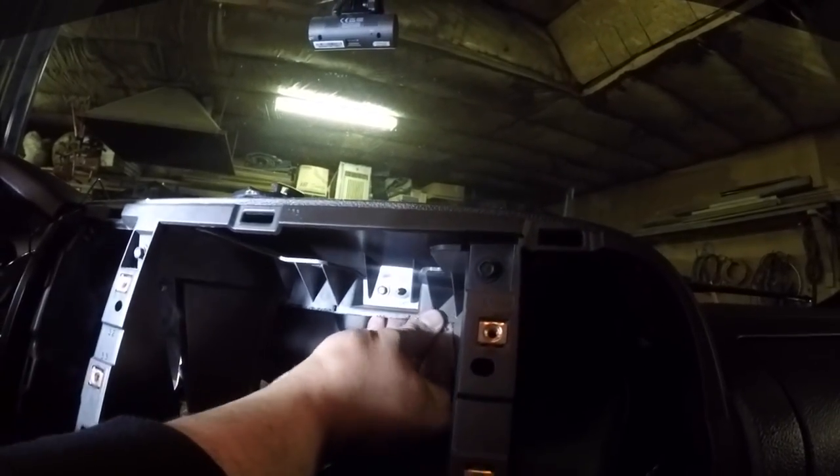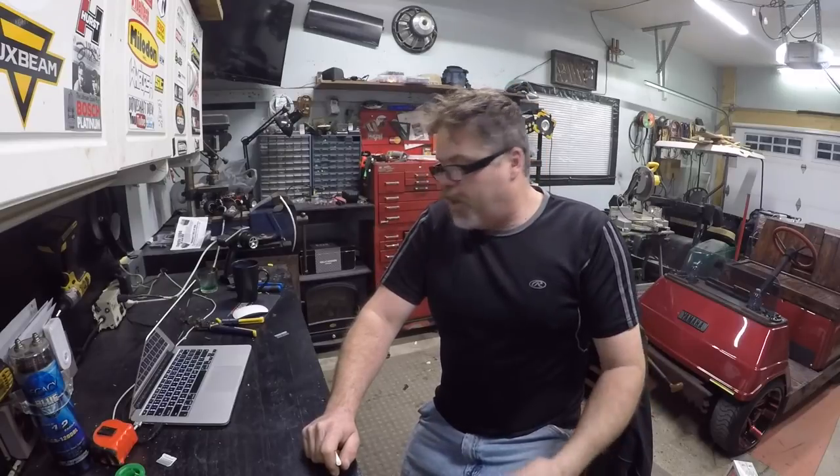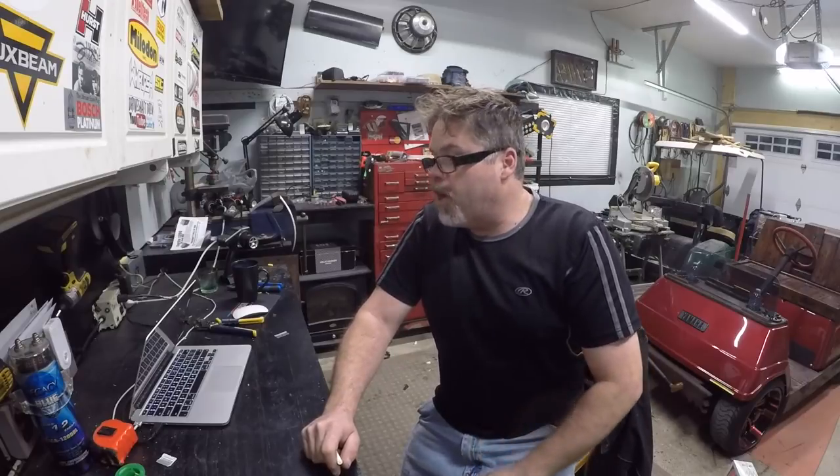Just so you know, you've got to pull that piece out right there. You don't have to if you're doing a single-DIN radio, but if you're doing a radio like yours with all the accessories, it's just a little nicer to cut that square out so you can throw all the modules back there. Look at the room back there! Boys and girls, we're back from the old stereo installation — she's in and she's working mint. Thanks a lot, Gatlin, for helping me out with that. It's always nice when you have friends. Don't forget to get over there and subscribe to Gatlin's channel — I'll put it at the end of the video and in the description below. Don't forget to subscribe, like, and hit that thumbs up button.